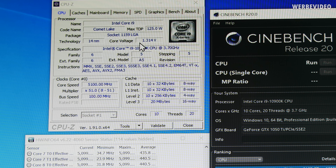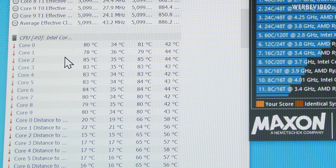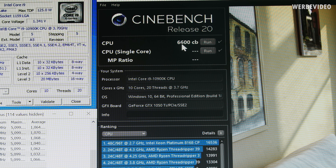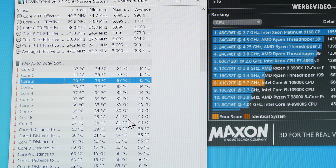You can see the CPU voltage is dropping down to 1.30-1.31 volt, which is a very healthy Vdrop. Temperature-wise we are in the mid-80s. Cinebench scored 6600 points. Lowest temperature is core 1 with 79 degrees Celsius and highest is core 2 with 87 degrees Celsius. Everything else is in the mid to low 80s.